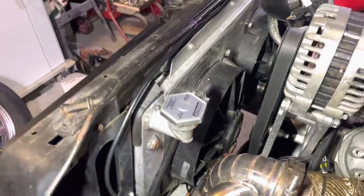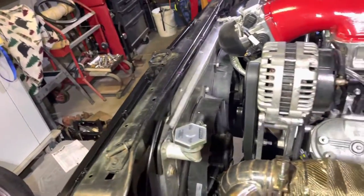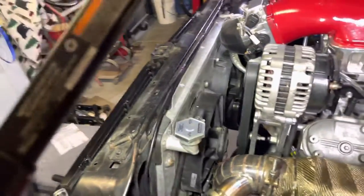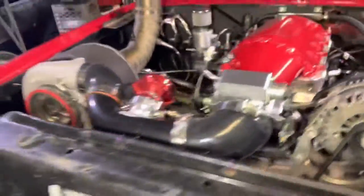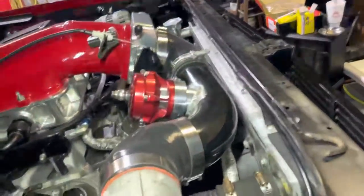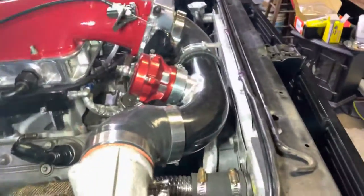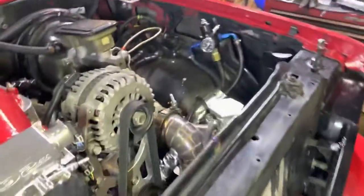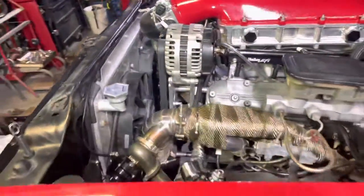This is the older one, so the fans are a little more bulky, but this thing keeps the whole truck cool. It really ever maxes out at like 204–205°F, and I just street drive it a lot. The new ones they make don't use epoxy to seal the radiator — they actually full-on weld it now, so there's really no chance of it busting. Their new fans are also a little slimmer, which makes everything a whole lot cleaner.